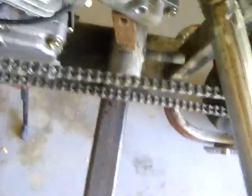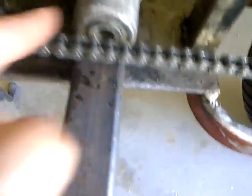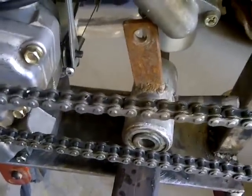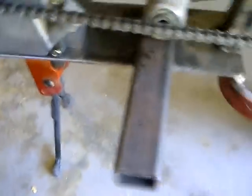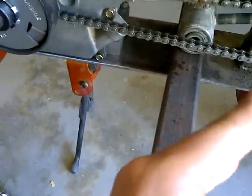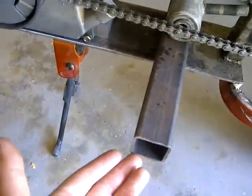My instinct is to just make my own jack shaft. As you can see right in front of us, I've got the solution already made — just weld this body to this guy right here. It's not going to be this long; just run a bead along the side so it's nice and tight. Everything is quarter inch to one eighth inch sheet metal, so it shouldn't be too tough for the welder to penetrate. I've got this open channel and it's solid — this is eighth-inch square. I'll just drill some holes straight through the running board and bolt it up. The beauty of that is I can camber and swing the angle as I wish once I get one bolt in. Just two bolts and I'm done.